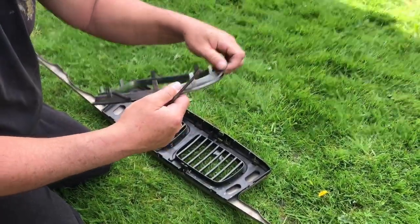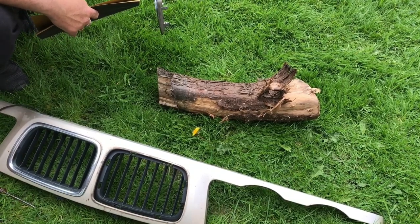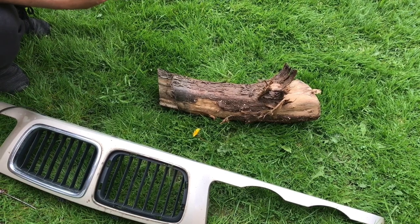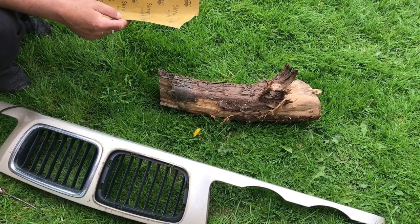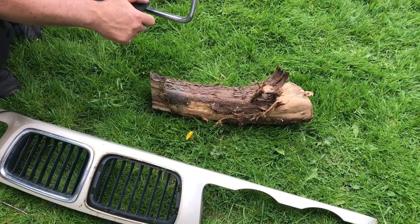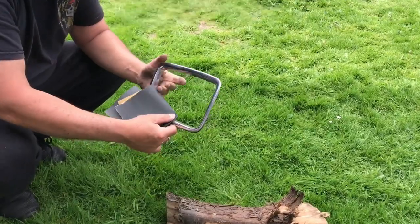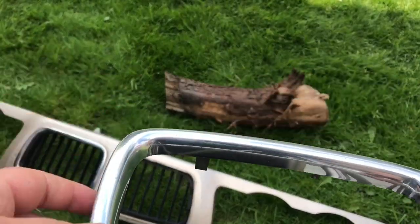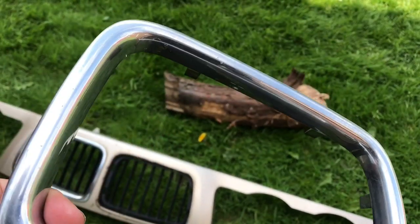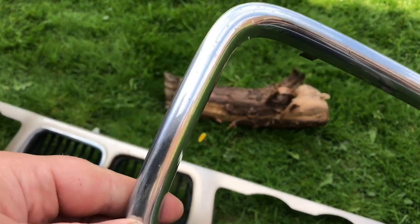That's one off. The next step is to take some of the shine off the chrome. It's only painted chrome, so take a bit of the shine off it with some light sandpaper. Not too gritty, because it will mark the finish. You just want something like 1,500, really nothing special. Just go over it so it takes the glint off the chrome face. And this is what we are left with, slightly dull all the way around, which gives an edge for the paint to stick to.